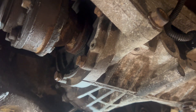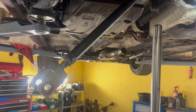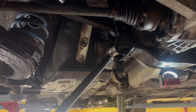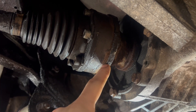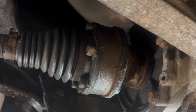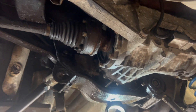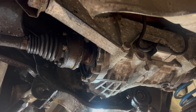It's a case of just bringing it backwards and dropping it down, then sticking the new one in. What I also needed to do as I was taking the shafts out: I just dropped the lower control arms in the rear, just to give me a little bit of wiggle room to get these out. These are actually a bit of a bear to separate from the cups in the diff — I was able to chisel them off. It's just a UK thing — they sit here and get rusty, and everything's just a bit of a nightmare to take apart after 20 years.